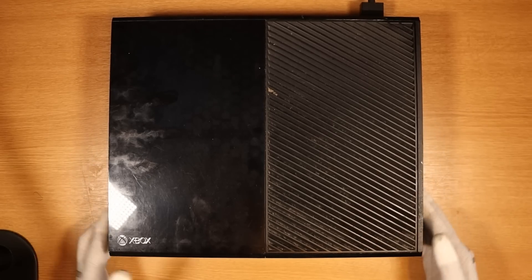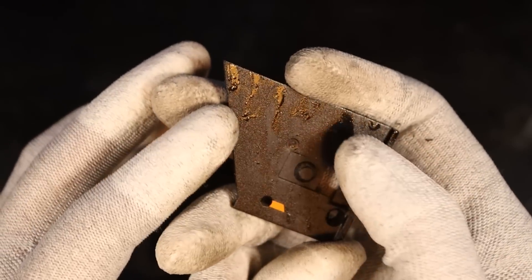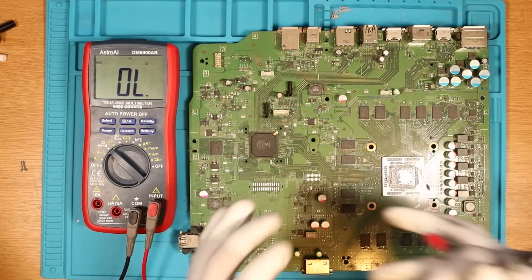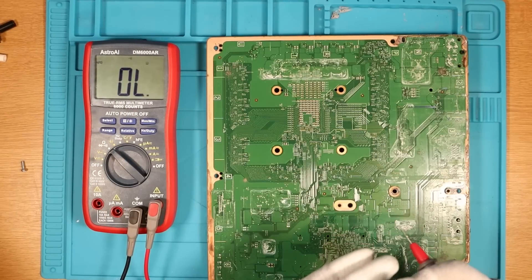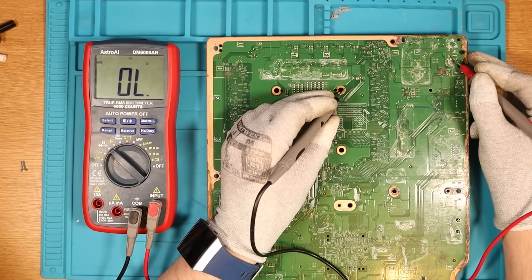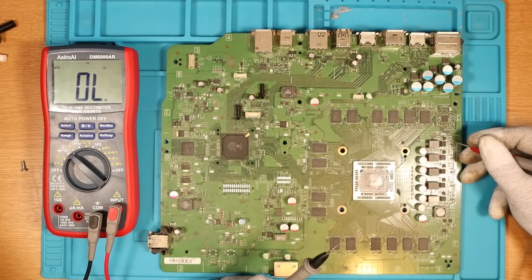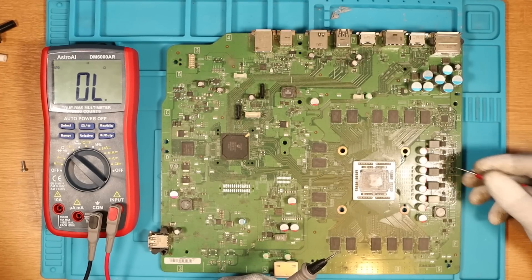Can we make that five out of six with Xbox number six? Wish me luck. Xbox number six — do you give us power? No, nothing at all. Whilst taking this apart, I've seen some sort of liquid — that's not good. Here we have the bare board. I've got the meter in continuity mode, black probe on ground and red probe on pin six of the power block input — this isn't coming up as a short, so we know the 12-volt line is fine. I put the meter into diode mode and checked the MOSFETs down at the power rail — they all check out at 0.6 volts, which is fine.